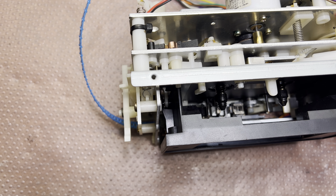And the last screw right here. Good — completed. The last part is to install this right in the middle, right there. Done. The only thing left is to clean the capstans, pinch rollers, and heads, demagnetize everything, and install it back. See you soon, guys!